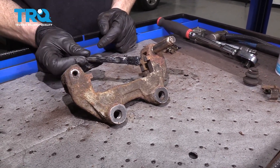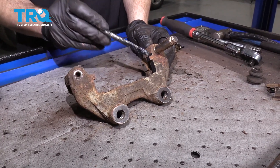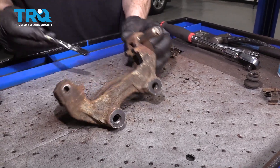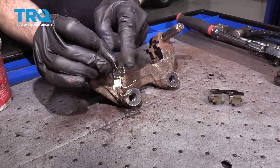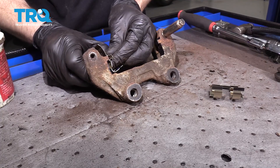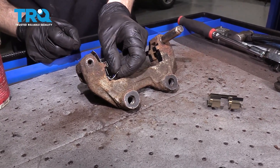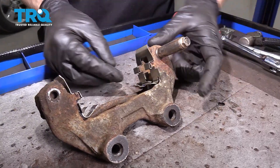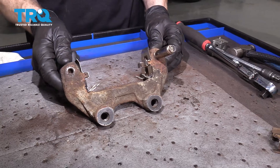Now I'm going to use a little bit of high-temperature caliper grease and go along each of these ears that I just cleaned up. This is going to help make sure that no moisture makes its way into this area, and it's also going to help with vibration dampening. Now let's take our brand new tins. What you'll notice is that it has a bobble that comes shooting out — that's the area that needs to go over each of these ridges. Carefully press it along there, line it up, and press it in to lock it in. Give it a little squeeze to make sure it's completely secure. Do the same on the other side of the bracket. Now we have our tins on there, and we're going to come back and lubricate this in a minute.